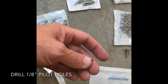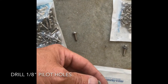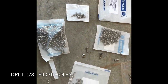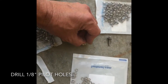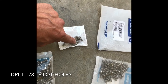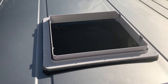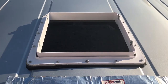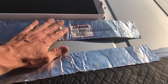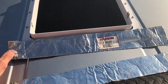This is the hardware I'm using: stainless steel three-quarter inch with a lock washer, and also stainless steel washers with rubber on the backside. In the middle holes of the front and rear, the adapter is a little bit thinner, so I'm going to put a lock washer on top so I won't pierce through the roof. On the four corners I will go through the roof with the one-inch stainless steel along with a lock washer. It's all mounted in. I'm going to put Eterna Bond seal over these screw holes on the roof for another level of water protection. Got this for free from the local insulation place.